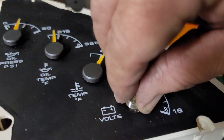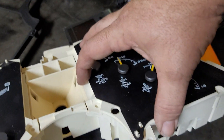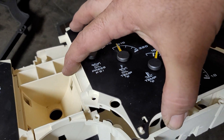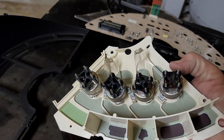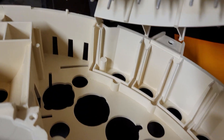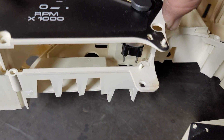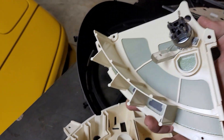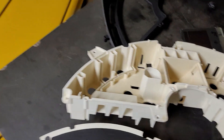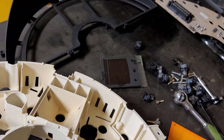There's the coloring in the back which creates the color, because the LCD naturally doesn't have any color, and there's a gasket right here. You can also very gently pull the needles straight up and they'll come right off. Then the gauge face pulls straight up and out — you can see the back side with those potentiometers, and the racetrack-looking channels that the components fit into. Then we just pull the tachometer straight up and out.